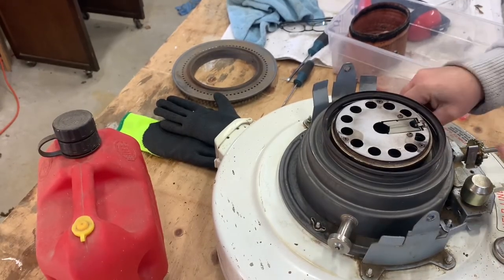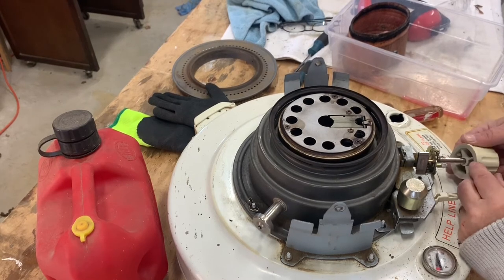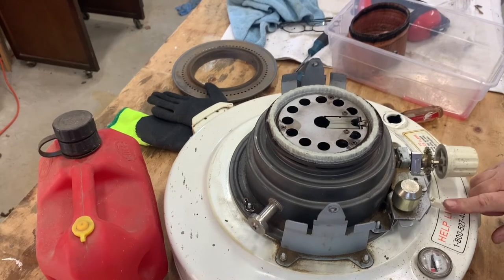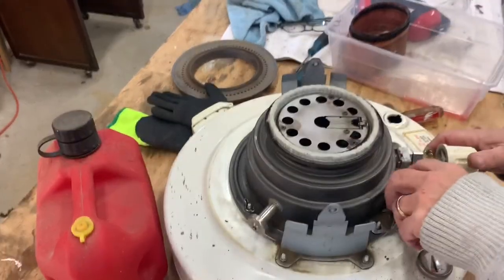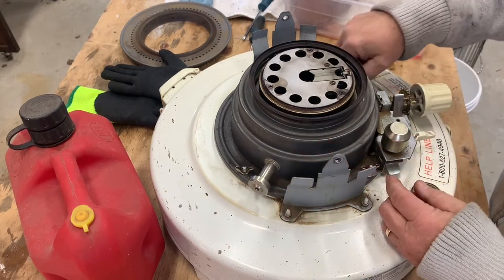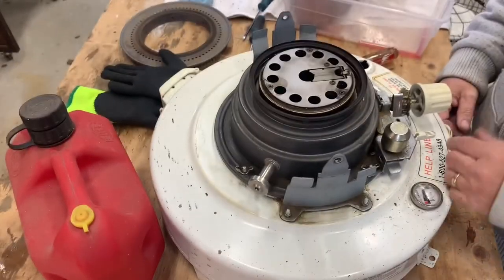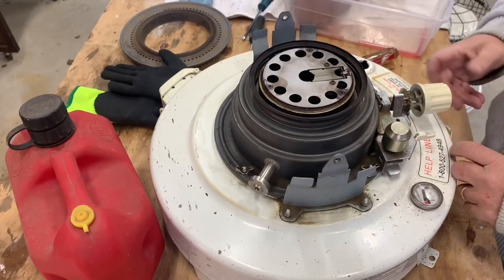There we go. I'm putting my knob back on — it goes on one way. There we go. Now if I turn this to the right, it should raise the wick. There — shazam. And then this should release it. That didn't work. I'm back — I do have this back together with all four wing nuts on now. Actually, I think having only two wing nuts on was contorting things a little bit, so the wick wouldn't go back down — which you see it does now. The other safety mechanism is the tip-over protection, which is this little wobble thing, and you can see that also works.